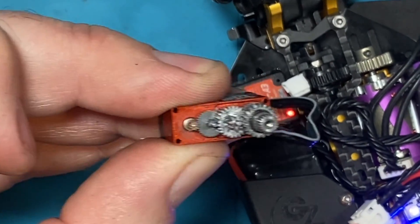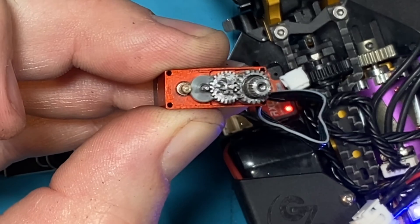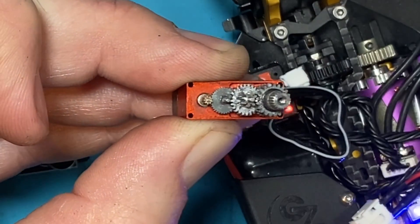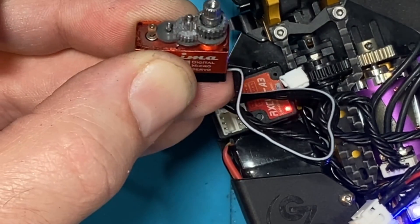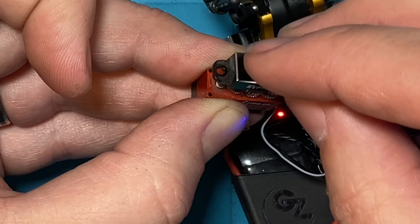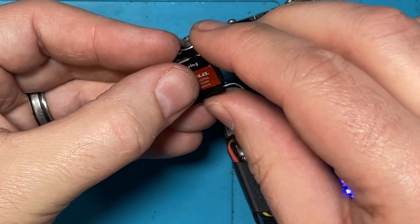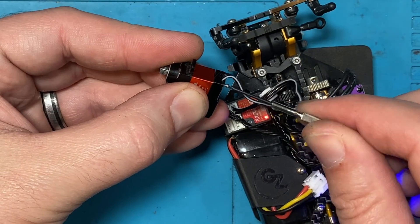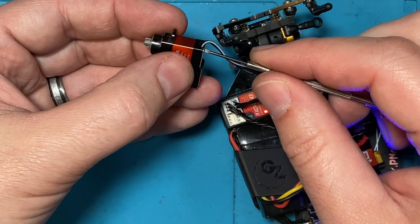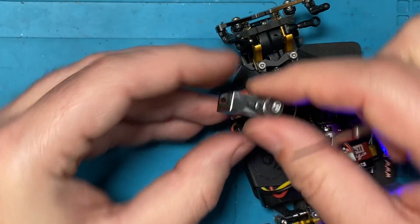You can see the max it moves - that's the max at least for the endpoints we had on this car. We could probably turn it up even more and you'd get quite a bit more movement before that chipped tooth would actually contact the gear, so I don't think it's ever going to contact. Let's get our bearing back on and get our housing back on. These servos aren't cheap - this is a $50 or $60 servo, so being able to fix it is super helpful. You can't buy rebuild kits or new gears for these PN servos, so if you break one, keep it - you can always swap out that one broken gear and save yourself $50 or $60.